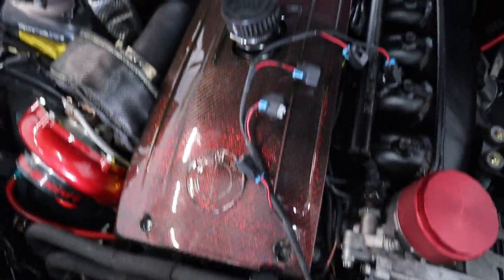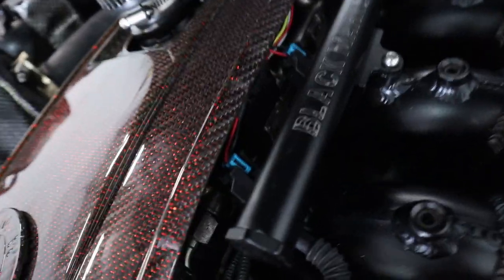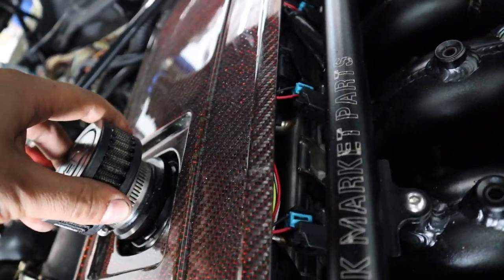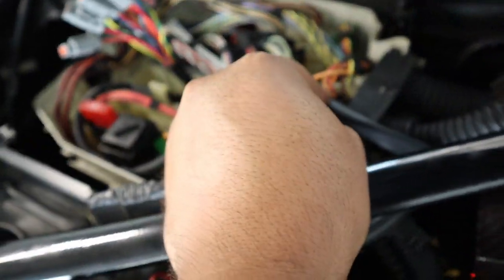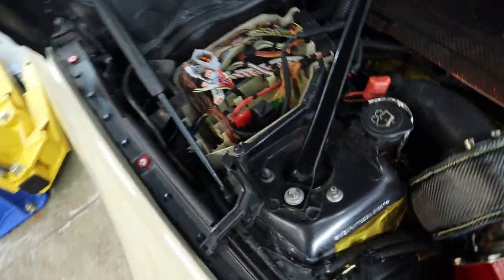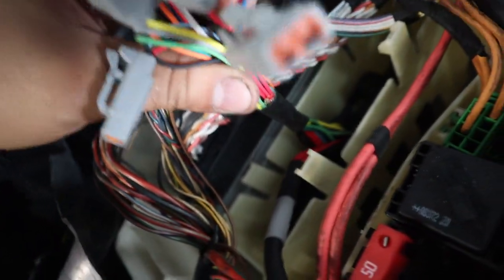The harness is in — all you have to do is plug in your six injectors. This is a top-feed manifold; if you have a bottom-feed just put the harness underneath and plug them in from underneath. I have the wire running under the cover going into the DME box, and I've already plugged it into the Reflex which is sitting right in that slot.